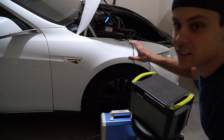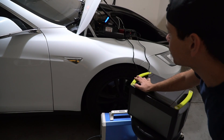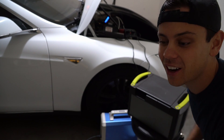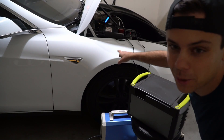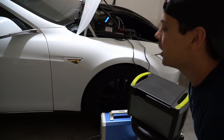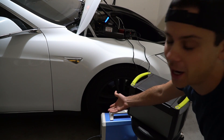Quick update: it is still charging these batteries and we're still at 13.9 to 14 volts. We could add more to the system, but I don't want to mess with my Tesla. You could technically pull around 50 amps from a comparable circuit, maybe pulling from two leads — you could even do 100 amps — but I'm going to stay safe because I can charge two batteries and this is plenty for backup power.